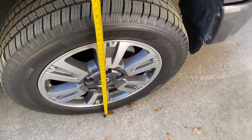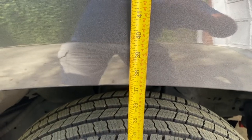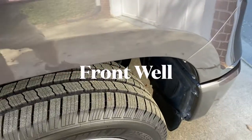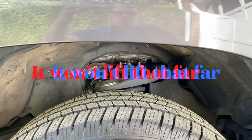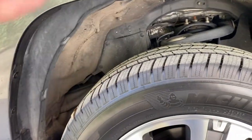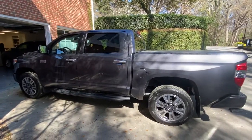There are a couple of ways to verify your weight distribution hitch is set up correctly, as explained in several manufacturers' videos. First, measure the front wheel well — from the center of the hub to the height of the wheel well, I'm at about 37 and three-eighths inches. Load your travel trailer on the hitch but don't install the weight distribution arms — the wheel well will lift. However much it lifts, say an inch and a half, adjust your lever arms to get that inch and a half back. At that point the vehicle should be fairly level and have adequate weight redistributed to the front end so the front tires maintain good contact.